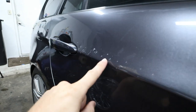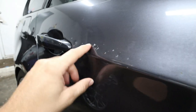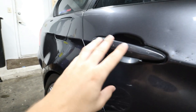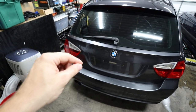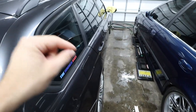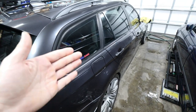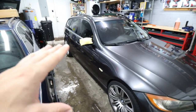The other thing I'm worried about is some little chips and dents — it looks like someone attacked this car with a BB gun. The chips of missing paint are unsightly and they go into the door handle, and we have another deeper scratch on the back of the trunk that even has a little bit of rust in it. Once the car is fully polished up, we'll remove that rust, add some rust-safe primer, and fill in those scratches with touch-up paint. This car might just be a 10-footer, but at 200,000 miles it's going to have some signs of use.